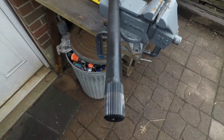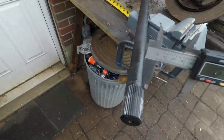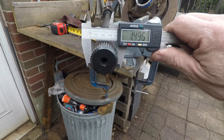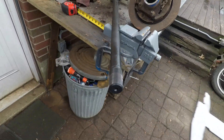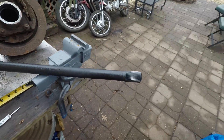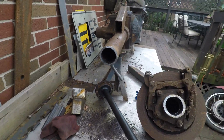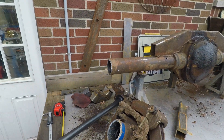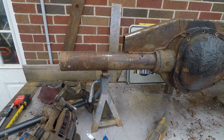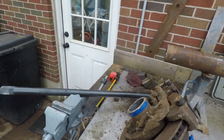The Sterling axle shaft does taper when the spline is out, but I'm a little bit worried about the splines. This is just for taking rough measurements. The Dana 60 axle shaft is an inch and a half down its full length. Now that I've got the measurements of the Dana 60 — from the hub face to the U-joint, to the C's inside and out, and the ball joint — I know some measurements to figure out what I need.